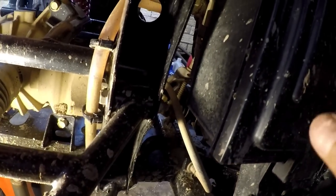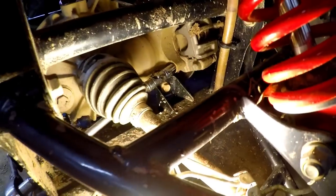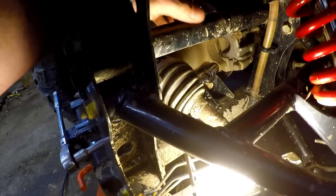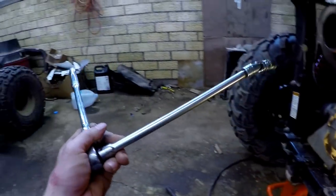Hopefully we don't have to take the battery box or anything out. Worst case scenario there's a nice big hole on the other side — we can pull the other tire off and reach through from the other side. Like I said, this is my first time tackling these as well. To get these bolts out, I found one of the easier ways is using a swivel head 12-millimeter socket with a nice long extension so I can work at it from the rear. That's a lot easier than trying to fight in here with your ratchet. I recommend using a nice long extension with a swivel head for removing those bolts.